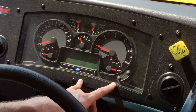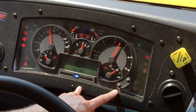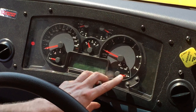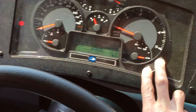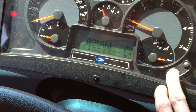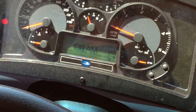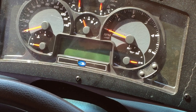To set the clock, with the key in the on position after all your gauges sweep, press and hold the bottom button. Your settings come up — use it to scroll down to number six to set the clock. Press (not hold) both buttons and release, then your time comes up. Go up and down to change the hour, press both to move to minutes, then up and down again. Turn the key off and it will be saved in the dash.